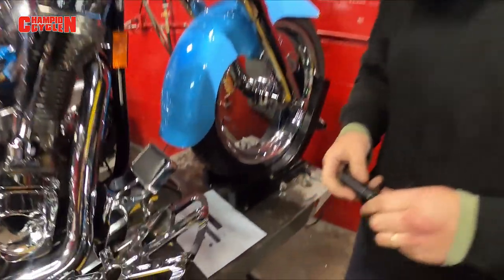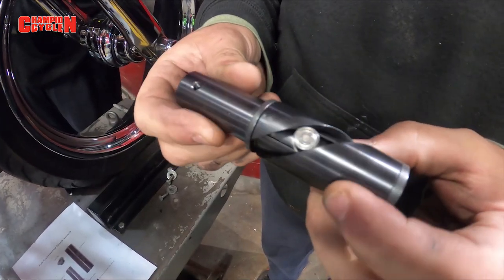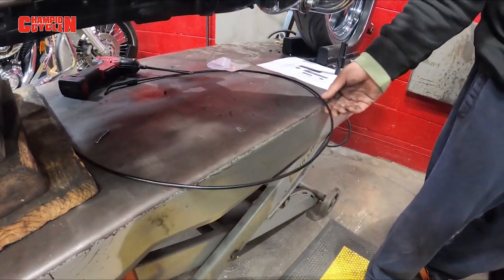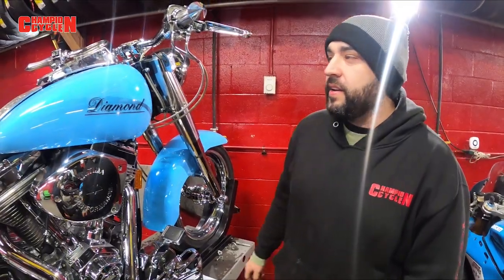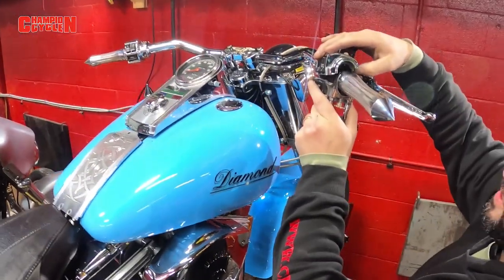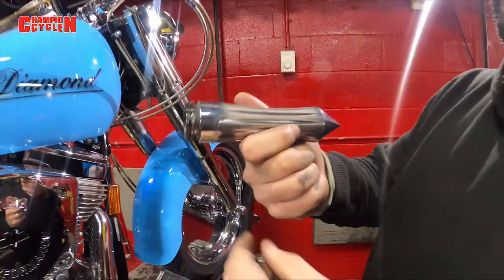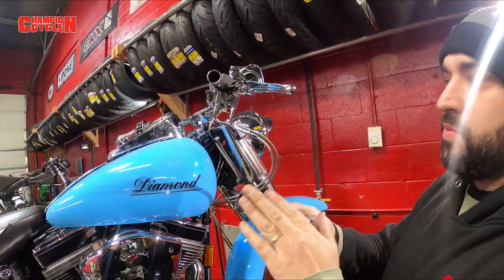What comes in the box? You get a handy manual so you know what you're doing. You get the actual full blown custom made trick part — that is the internal throttle assembly. You get a cable and a bag of odds and sods. You want to take off your throttle cable housings, just let them dangle. Remove your grip — grip's a grip, right? Throttle cables will look the same unless you've got a newer model with fly-by-wire throttle. This is for throttle cable equipped bikes.